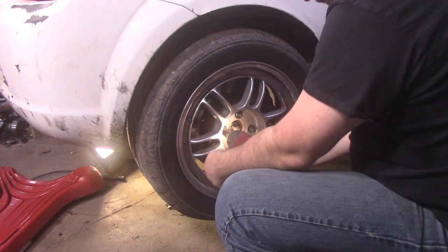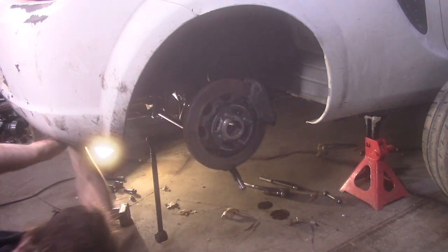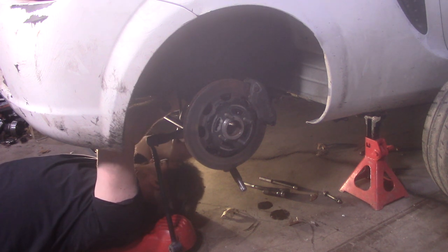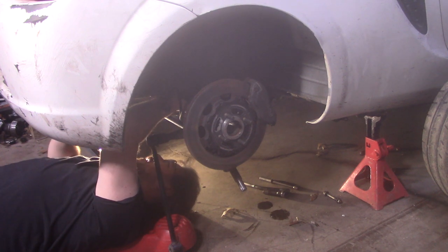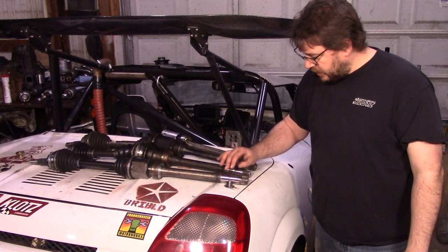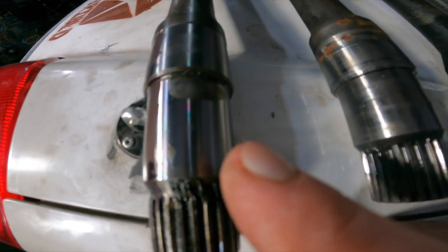I went ahead and confirmed on my documentation the right side shaft is the shorter shaft. I also measured these diameters here — these diameters are exactly the same as the other ones. Really the only difference on the outboard here is that this seal diameter is longer. That shouldn't cause us any issues, though the extra length might. So we're going to see. Pretty sure it's the transmission we're bottoming out on, not the bearing. So as you can see under there, this shaft is definitely too long. I put some grease on here to be able to tell where the interference was, and it's right at this shoulder here — you can see the grease here was moved, whereas up here it wasn't touched. That's just a quick way to tell where the interference was.